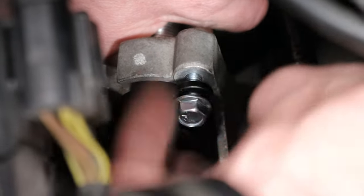Now you need to insert the C-clips that hold the shifter cable in place. The space is tight, so it may be difficult to get these back in there. Use the end of a socket to tap the shifter cable clip back into place. You can use pliers or other hand tools to install the other cable clip. Once the clips are in place, your cables are now installed. Row through all the gears and make sure everything feels great. If everything's good, you can now reassemble your car.